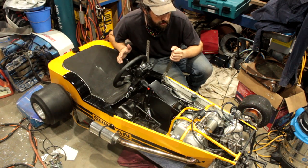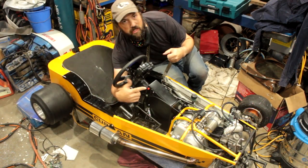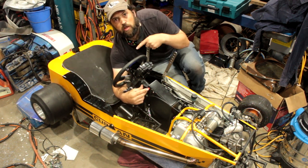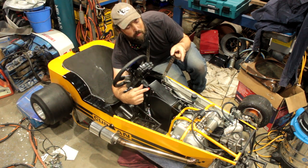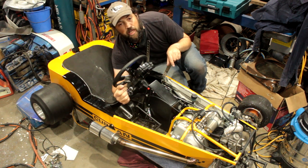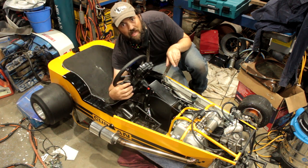It's all back together. I now have the pulse pump hooked up. So, let's see what happens. First thing, we turn on the key. All the dash lights up. Now, this little red button on the side here triggers the relay to turn on the old fuel pump, because it draws too much power to run constantly. So hopefully I can press this and it will prime the fuel system. If I hit the key and it starts, then the fuel system has primed properly, because the carby was totally empty.